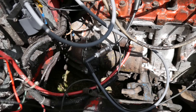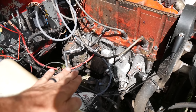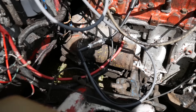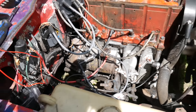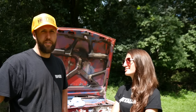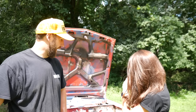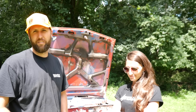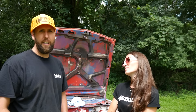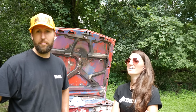I got my spark tester hooked up again and we just tested that on Jessica's daily driver, just to make sure it's still working — and it does. So this is it, she's going to fire. Go ahead and flip the switches and hit the button. A little hand-starter jam. That's good. So this is where it's going to get interesting, because the only thing left is either the entire car is bad, or it's the distributor because the pickup shot in it — and I've already put about 48 gallons of brake clean down that. No one's going to have a distributor to a '77 Monza in this town, so we'll get on the old interwebs and see what happens. We're going to have to splice this episode together because you're probably not going to see us until December, but we'll make it happen. I really do want to make that race Saturday.